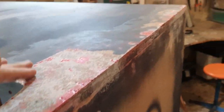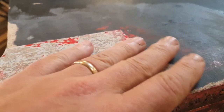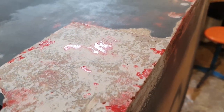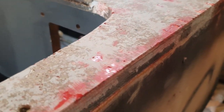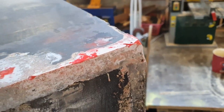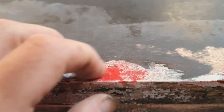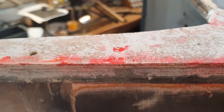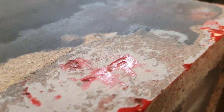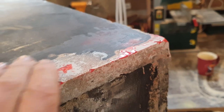Here I'm filling the little gaps with Bondo so I use a lot less of it. What I do — and I've done this on the other side — is use a red paint or any color that's not black or white, something visible, and spray the area I've patched. Then I sand it back down and it exposes where it needs a little bit more filler. I lightly sand in the grooves to provide a better key. Last pass of sanding — it looks smooth enough here.